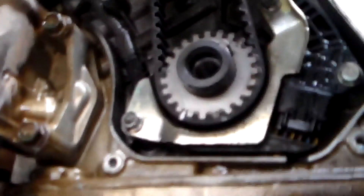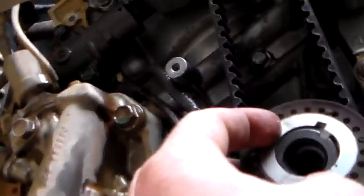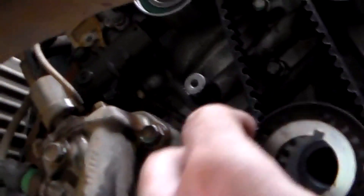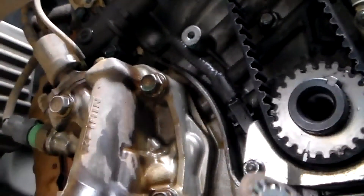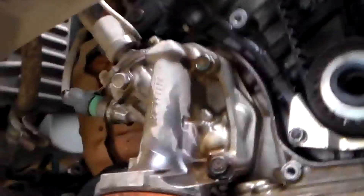I'm going to put this washer back on the crankshaft — that big washer-type thing that came off of it. It's kind of beveled; put it on so the edge is beveled out toward you. Then I'm going to go ahead and put my crank pulley back on temporarily and run my bolt back in there, just hand tight.